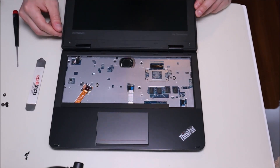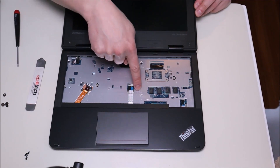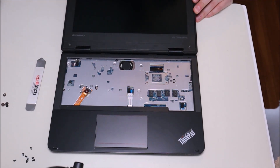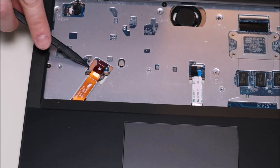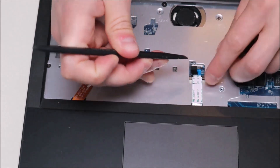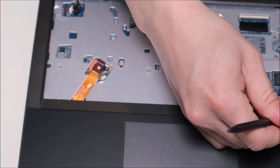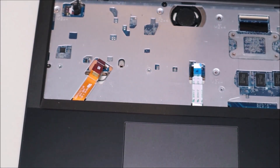To get further into our computer before we can separate the palm rest and the bottom case, there are four screws under the keyboard that we'll have to get at. Also, there's a ribbon cable here that comes up over the panel and plugs in — we're going to separate that the same way we did the keyboard one. Take the plastic pry tool, put it underneath that clip, pop it up, and slide out the ribbon cable. I'll do the same over here — this one probably goes to your touchpad. There's also one last ribbon cable here; always better safe than sorry. Pop that up and now it's loose.